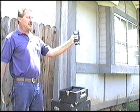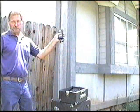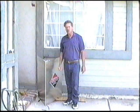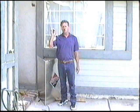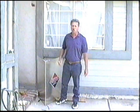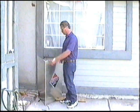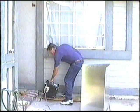We're now doing the microwave treatment. The first thing you want to do when treatment begins is pick up your microwave leakage detector and check the area to make sure you're not getting any exposure. When the time is up on the control panel, remove the key and put it in your pocket so nobody can turn on the control panel while the operator is moving the unit. Now it's time to remove the shielding and move the unit over.